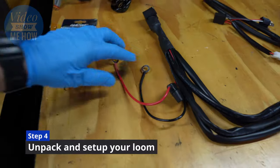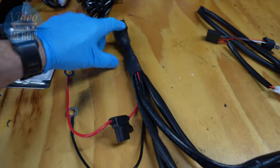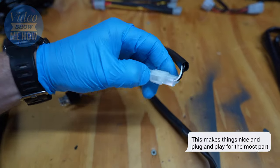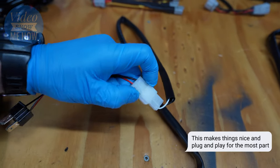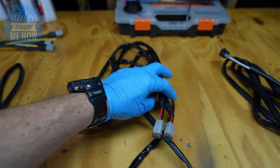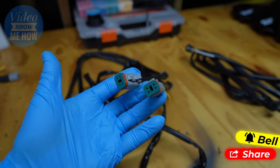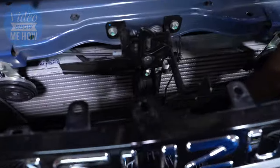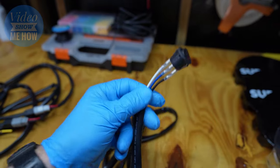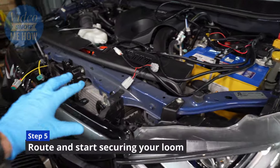Here's the full kit laid out. We have our two battery connections, all pre-terminated, our 30 amp inline fuse, and everything is run via relay — everything is heat shrinked. Coming along here we have the high beam input, but we want to get rid of that because it's not going to suit our D-Max. We want this particular loom — this is our factory connection. Moving along this is the output — the connections to our spotlights themselves. You'll want these if you're going to be running the daytime running light. Those plug straight into the back of the spotlights via the same waterproof plug. And down the end here, this long bit of cable — this is what we need to send through our firewall and install in-cab so we can switch the lights on and off. Our next step is routing and securing this loom into place.